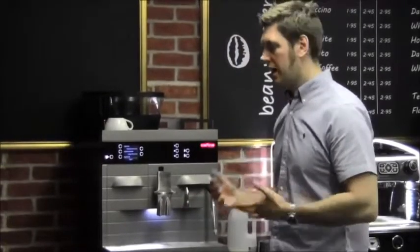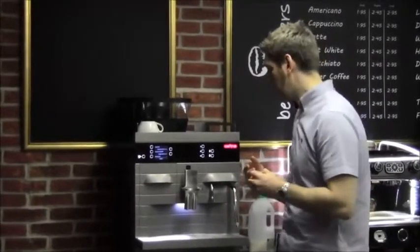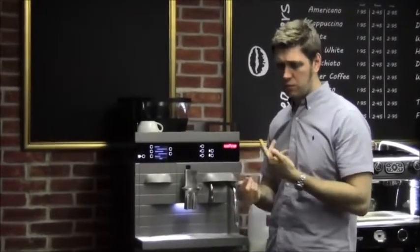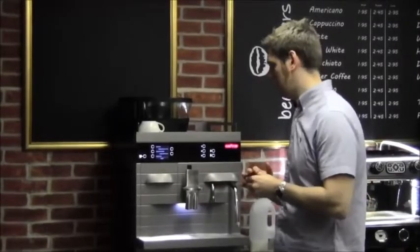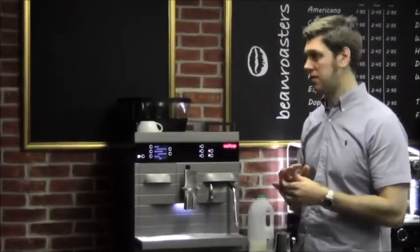On that system, the point to note is it doesn't just use venturi — it uses something called the geared milk pump. What it does is it basically slows down or speeds up the delivery of the milk through the jet of steam, which produces the foam in the drink. Most bean-to-cup machines have a problem where the milk isn't hot enough. By slowing down the flow of milk through the steam, the milk is in the steam for longer, giving you a higher temperature on the milk foam. It will also smash apart the larger bubbles producing smaller bubbles, so you end up with a finer milk foam — more like what you'd get from a professional barista using a traditional machine. The geared milk pump also has hygiene benefits as it's better at cleaning itself through.